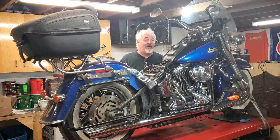So while we're in it, instead of just buying a set of stock cams, I put a set of 255s in it. Nothing crazy. Like I said, they do a lot of miles, so it's pretty much cheaper and a little bit better if I put 255s in it. So that's what we did. We pulled it all apart, got it all back together. She's a 103 right now with a set of 255s.